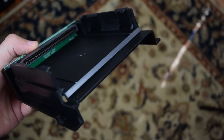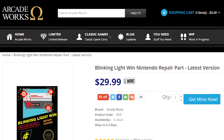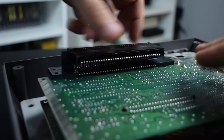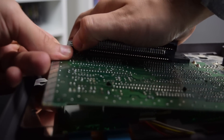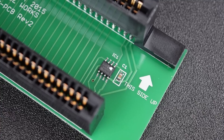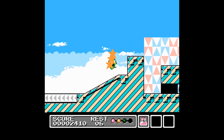And that's where Blinking Light Win comes in. It fixes that problem by replacing both the NES's pin connector and loading tray. Games load horizontally rather than at an angle, which increases the lifespan of the pin connector dramatically. Quan Win, owner and head engineer at ArcadeWorks, introduced the idea in December of 2014. I recently picked one up for $30 at the Game On Expo in Mesa, Arizona, from the ArcadeWorks booth. I've replaced the pin connector on my NES three times in the past ten years, so I was ready for a permanent fix. Blinking Light Win also has a built-in lockout chip on the PCB that intercepts the region lock communication between the game and the system, making your NES a region-free console.